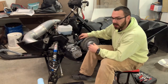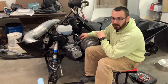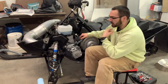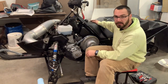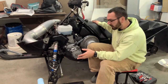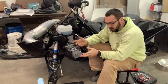With that being said, I would safely assume that all the lines have the bubbles out of them, or at least all the lines have oil going to the check valves — which means in my eyes I'm going to be safe to ride this with the premix I have in it. Obviously it's not going to rev out all the way because it's getting too much oil, but I should be safe. If you guys have any questions, message me on Facebook or comment on the video.